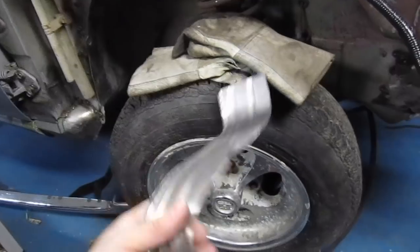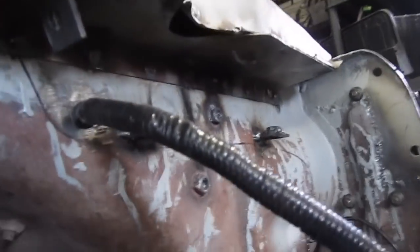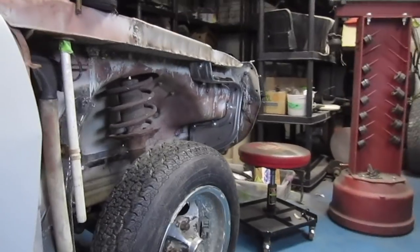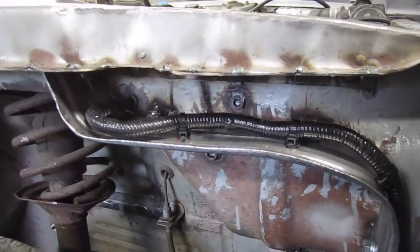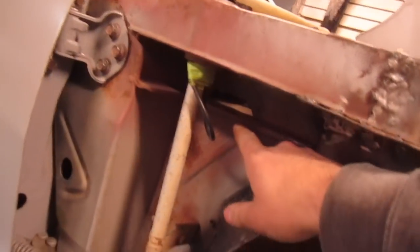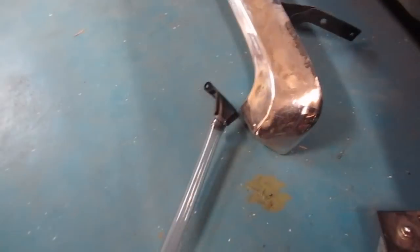Here's the wire shield that I've made for the passenger side — that will go up in here. For this wiring harness I'm doing it a little differently: this is going to be a bolt-on piece. I've welded tabs with weld nuts on them. Here's the wire cover for the passenger side wheel well — it's all bolted on so I've done a couple bolts in here and this one's removable. It's clipped on with these zip tie clips for the wire loom — you can see they come through with the Christmas tree ends. It kind of comes through behind the fog light here, and I'm going to extend the drain tube from here down to the bottom.